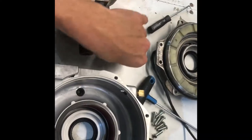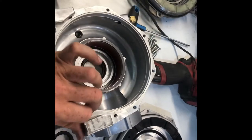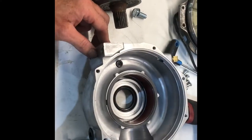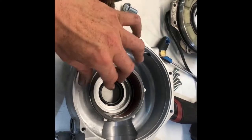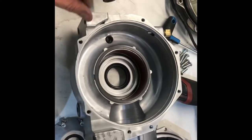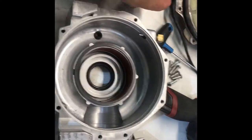The factory bolts are probably only about this long. Use Loctite, and make sure these surfaces down here on the frame are clean when you put it in so it seats nice and easy. You can throw a little Loctite on the bottom and it'll help lock it to the frame — not that you don't need bolts, but it's just a little insurance. Loctite actually works when you pull the oxygen away from it — when you smash it into threads and the air goes away, it hardens up.